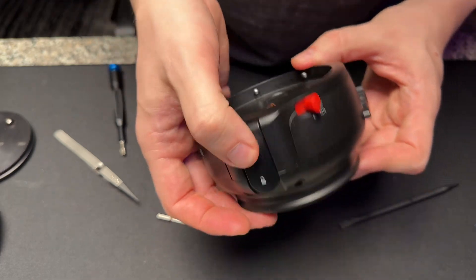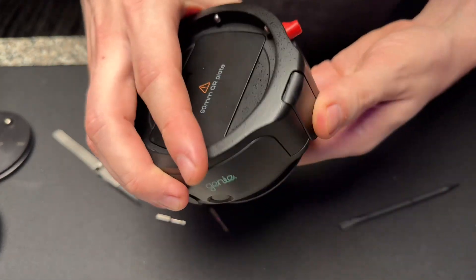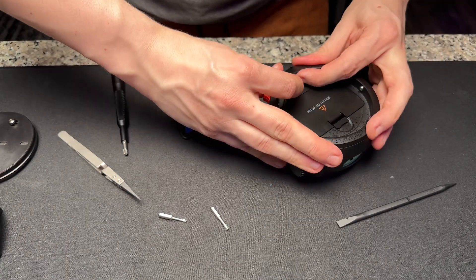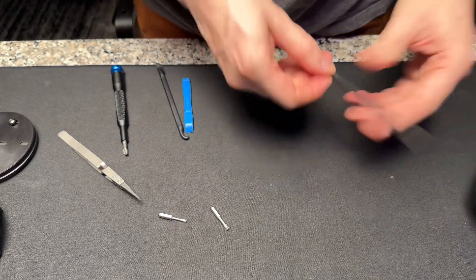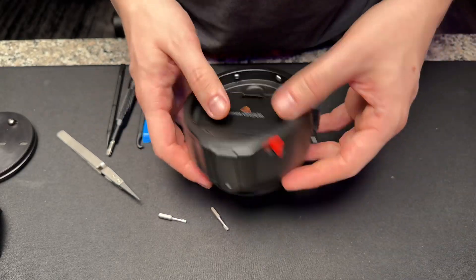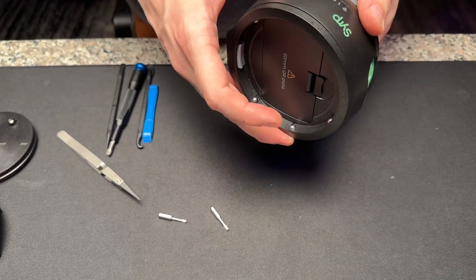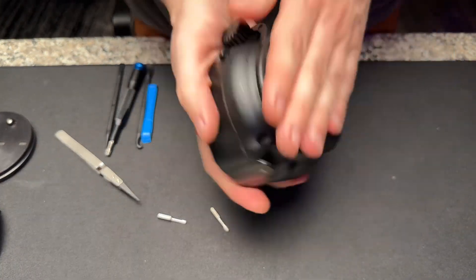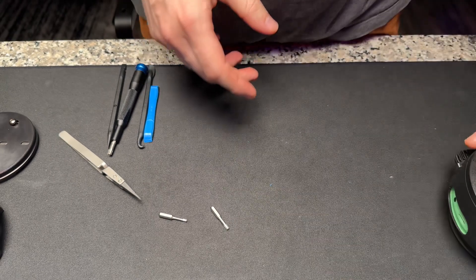I want to remake this latch in metal because the plastic is just not good enough. I'm going to try to get somebody to model it and maybe do a CNC cut from aluminum — just push the pins through, and it doesn't even have to be that perfect. So this is how you take apart and put together a Genie 2 Linear to fix this issue. If you need parts, go to ManfrottoParts.com — you can order using the model number of the Genie. It shows you all the parts available in a PDF document, even the casing and housing. You're pretty much only going to need this plate, and it does come with the metal piece too.